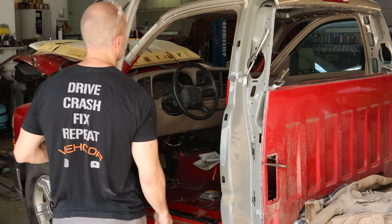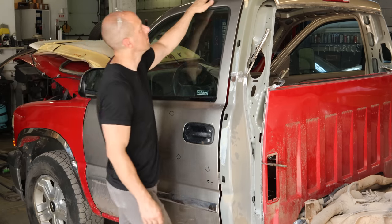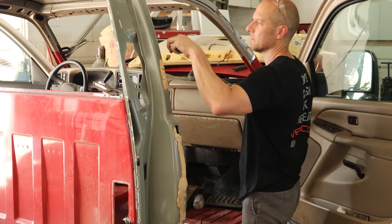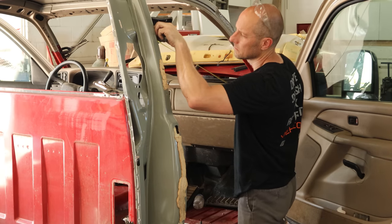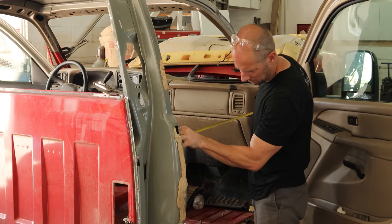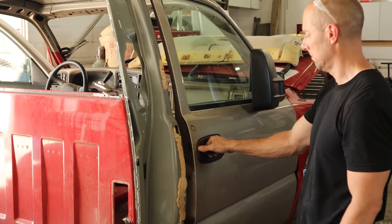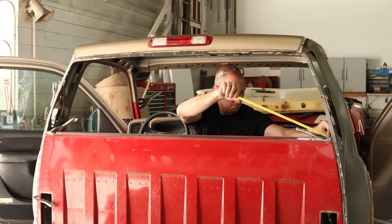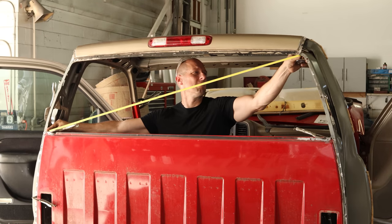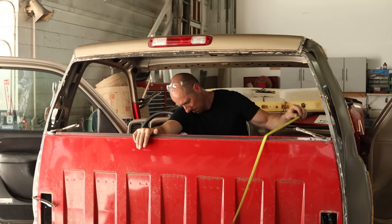It's always harder to move everything after you've welded it up, but our door closes pretty nice and our gaps on the roof look good. It's always good to pet the truck a little bit and let it know you mean it no harm. I took all these measurements off the original cab before I cut it apart. I did have some measurements from data sheets, but not quite as many — I like as many as possible — so I used a combination of both. Now we'll measure across our window and make sure everything is square, because we did have those B pillars loose and they are flimsy. As long as our measurements are okay, our glass should fit in there.